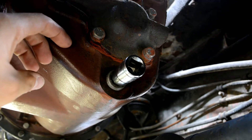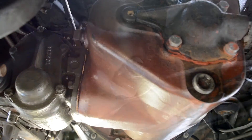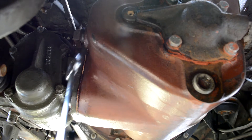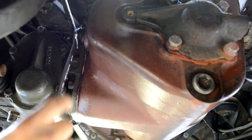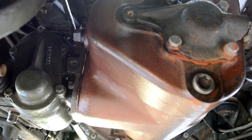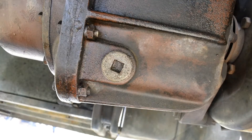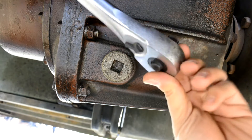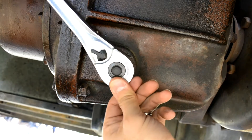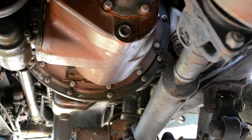Now let's look at the other options you might find on your Deuce. Here is the transmission fill plug, and that is a 5/8-inch square plug. I've already loosened everything up here because who wants to see some dude just struggle with bolts all day on YouTube. You may also come across a plug like this — this is on my transfer case but it could be on your transmission as well. You can just use a half-inch ratchet and it goes right in there perfectly. Okay, time to start draining.